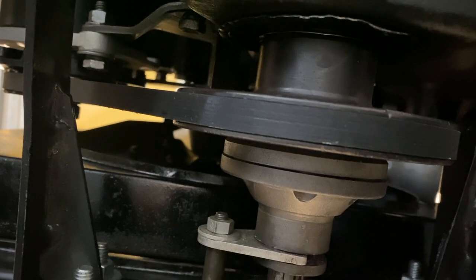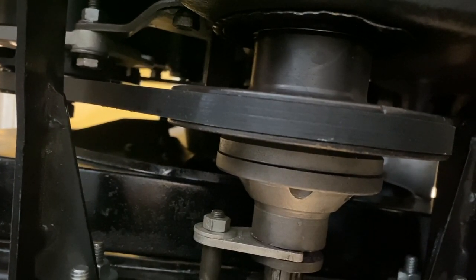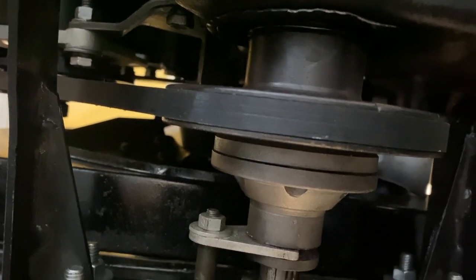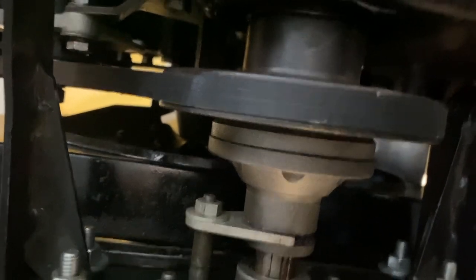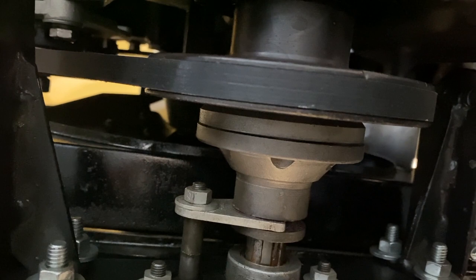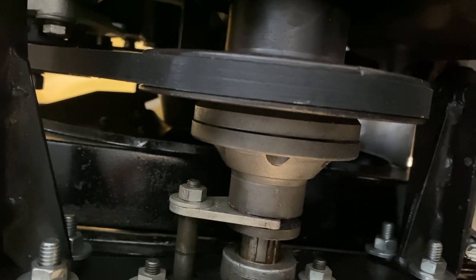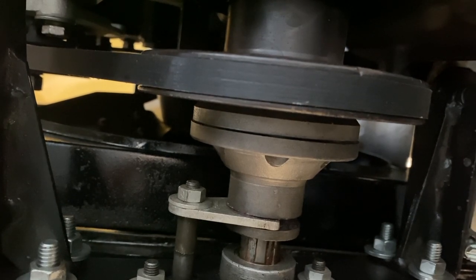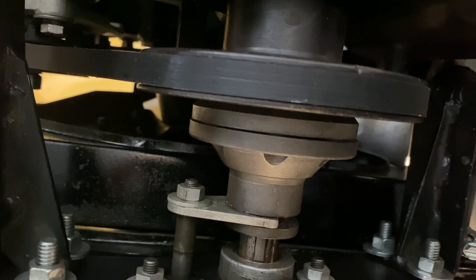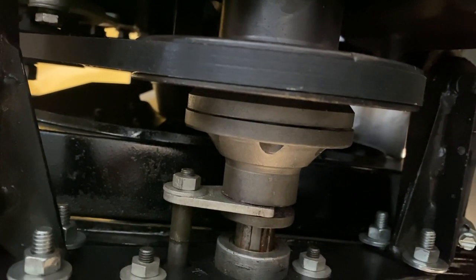So you can see that if the crank is turning and you just jam that in, then it's going to be an awful jolt. And so it's a better idea just to go and hand fit that, and you can rotate the collar so it aligns with the pins, and then manually use the lever and transfer the drive. And once you do it a few times, it's relatively easy. I suppose if you're in a big puddle of mud, it might not be.